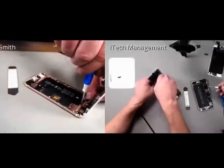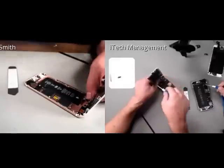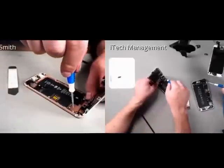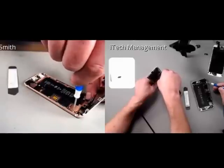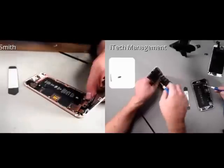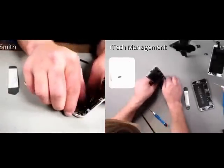There's one non-magnetic screw that is always a pain to get in, which is probably why we use screw grab. All right, but it looks here on the 6S that they use a standard standoff screw for the outer perimeter screw of the bracket, which means we don't have a problem with them being non-magnetic.